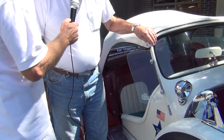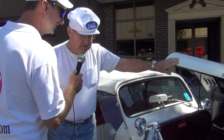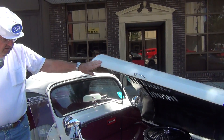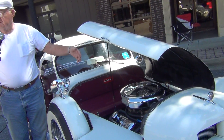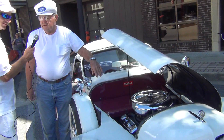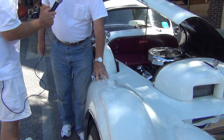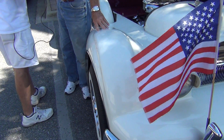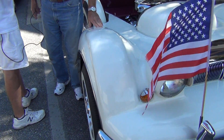That's what this is about. This is a custom rear window out of a '42 Commander — a Studebaker Commander. This is a piece of sheet aluminum. We made a frame out of wood bucks and then bent it over it and braced it. These started out as '39 LaSalle fenders, but then we took the other half of those trailer fenders back there and put them up here and flowed them in here — with lead.